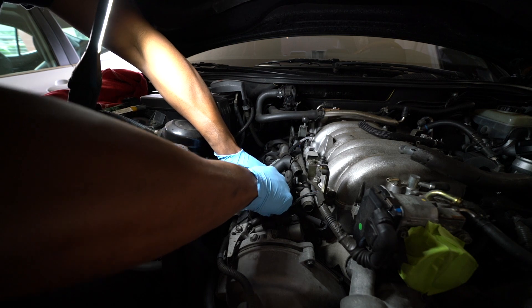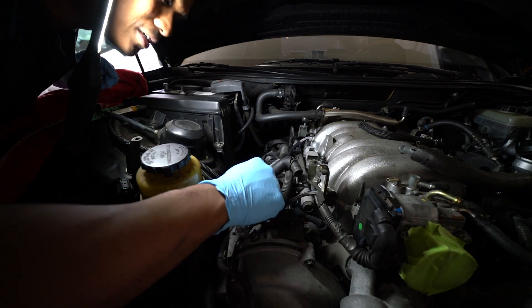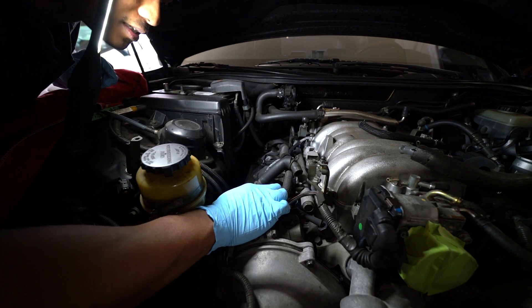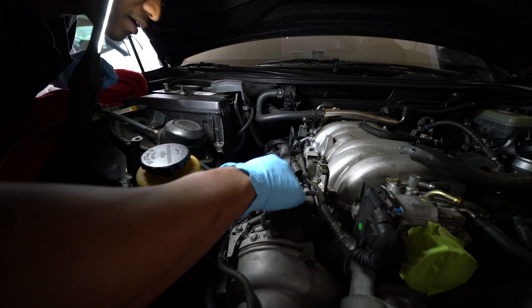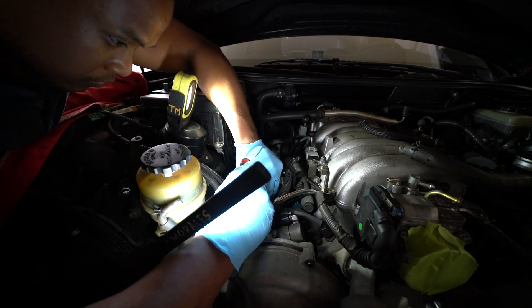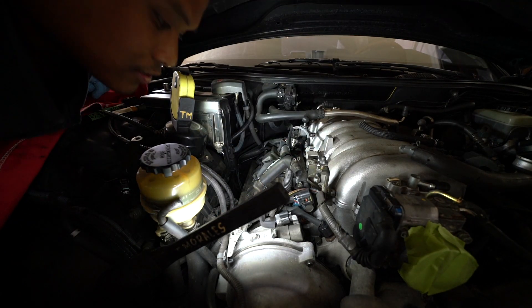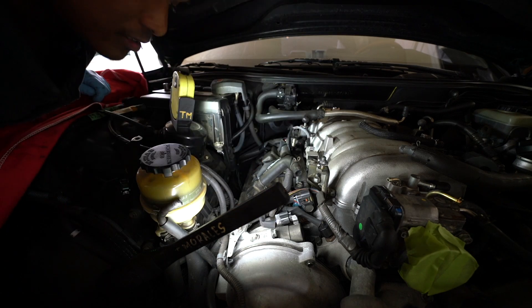Got the oil draining, radiator pretty much in, cooling hoses hooked up, trans cooler lines hooked up. Next I'm going to start on the valve cover — passenger side first since it seems easier, then move to the driver's side which is going to be a challenge. Watch out for these spark plug coil connectors — they tend to break because they're so old and plastic. I'm probably going to break a few, but just be careful. Take out the coils with a 10mm and put them back where they came from.